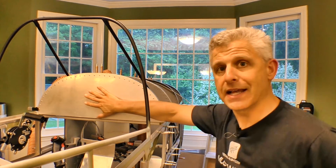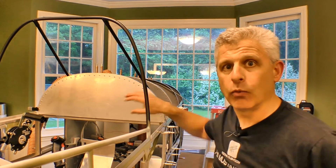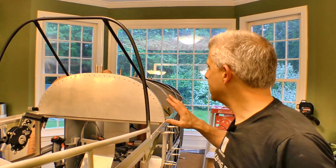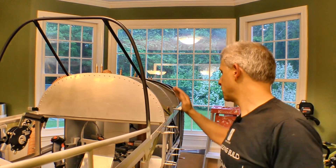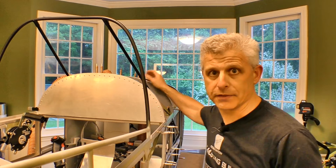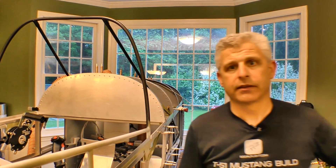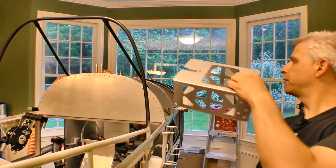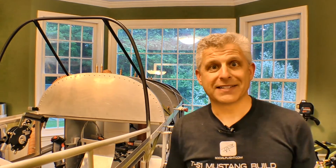Since we have this panel in place and it's solid right now, it is a great test piece for us. We're actually going to mark out where the stacks are going to go, mount the trays to the back of this support first, and see how they fit. We also need to cut access holes in the next station bulkhead — station number four — as we move towards the front of the aircraft, because you have to be able to get the connectors out. If we take a look at a tray, this is a tray for the IFD 540 — a pretty long unit that has to go from this station all the way back to reach the connectors.